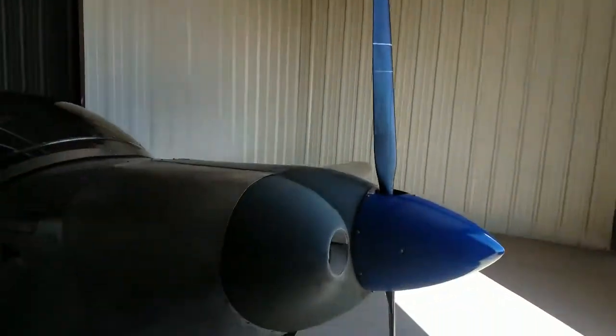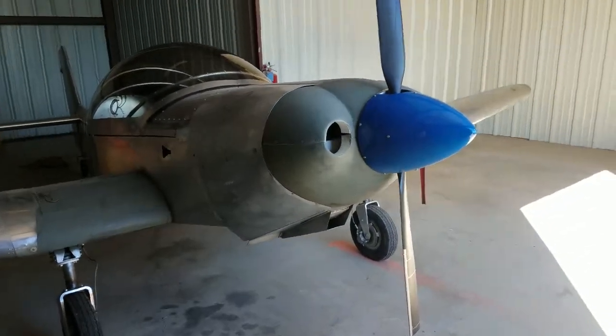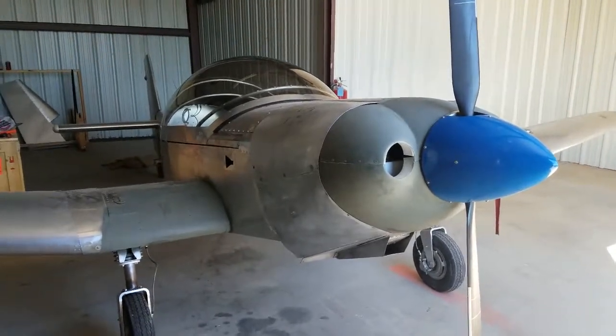If you have more questions, I'll put some links to William Wynn's site in the description. Now let me show you some of the things we've done to get this thing ready to go again. We replaced the prop — brand new prop. I got this one from another Corvair builder who went to a whirlwind prop, so I bought his off of him. Got the spinner back on and balanced it out.